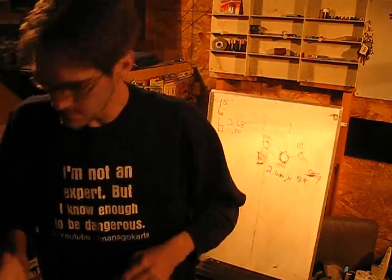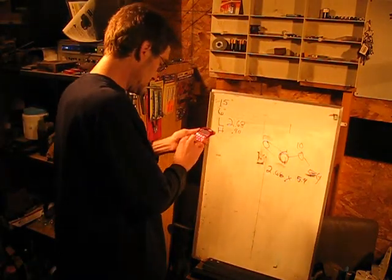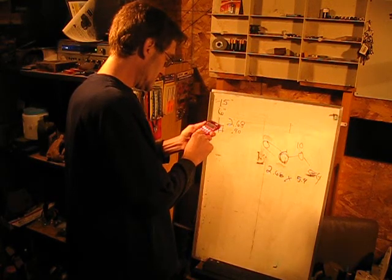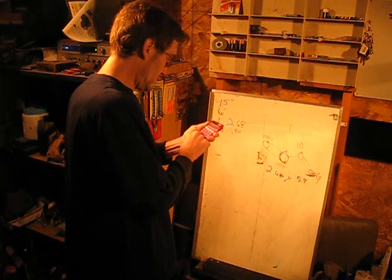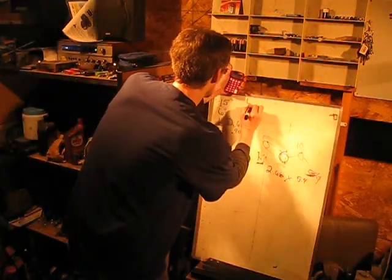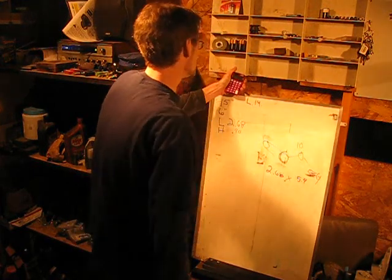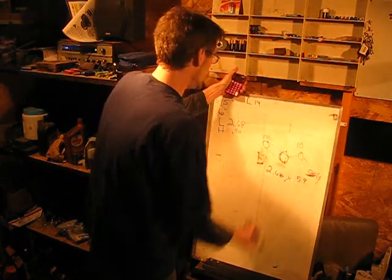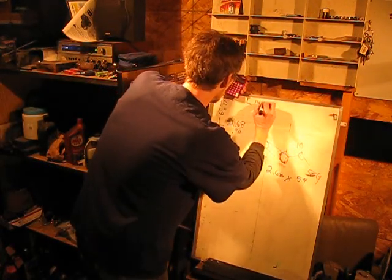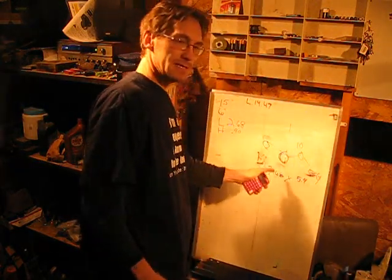This over here was the 5.4, so you multiply those together. Oh no, now I've got to get my calculator. Okay, so we have 2.68 times 5.4, which equals 14.47. At low, we're at 14.47. That's the gear ratio as it is sitting there.